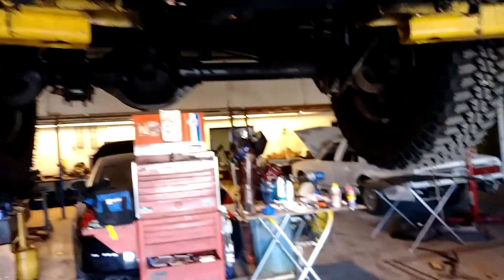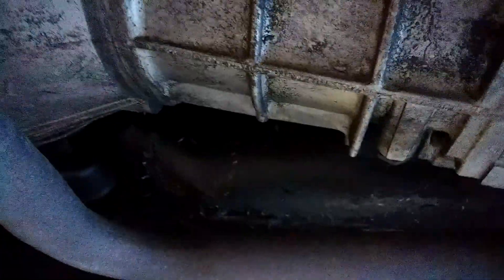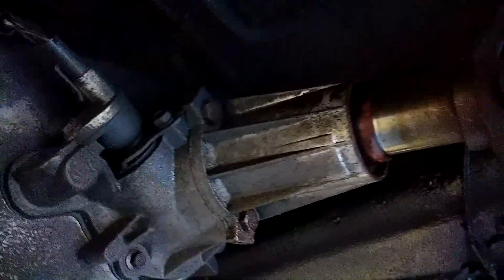Got the sway bar on. I have time right now but I'm not going to do it — I need to change the transmission fluid. It's a manual but still needs changed periodically because this thing grinds going into reverse and I have a feeling it's because it's low on fluid. I also need to change the transfer case fluid, but that may wait — it's a little damp.